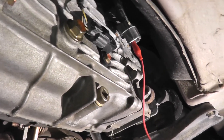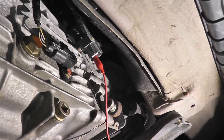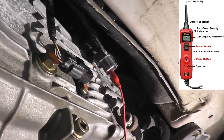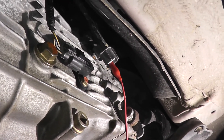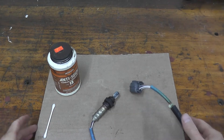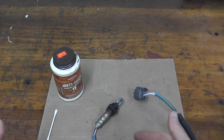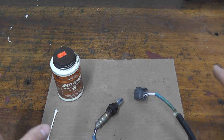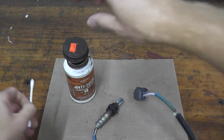If you test all four prongs and you're not getting power, then you have a break somewhere in the wiring — that can be really tough to find. A tool called Power Probe makes it incredibly easy to locate any wiring breaks; I'll include a link in the description. Chances are if you have this trouble code, most of the time it's just the sensor. If you do need to replace it, go with the factory sensor — typically Bosch or Denso. Do not go aftermarket at a local auto parts store because they often don't last very long.